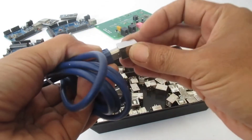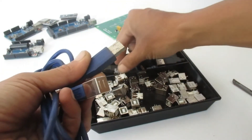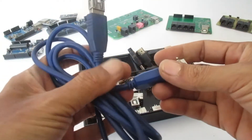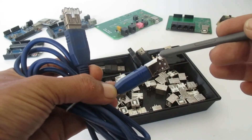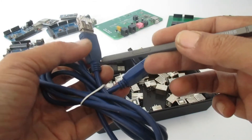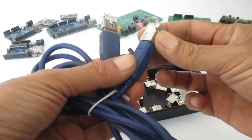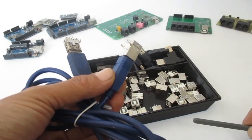When connecting a device using a USB cable, one end of the cable plugs into the device and the other end plugs into the Female USB connector on the computer — it usually looks like this. What I want to describe is that in this connector there are four connecting points, which go through the USB cable all the way to the other end, where there are also four connecting points connected to the chipset on the computer.